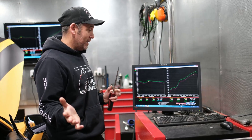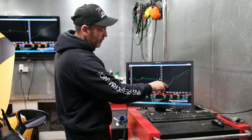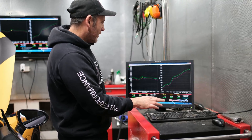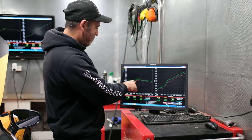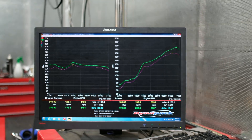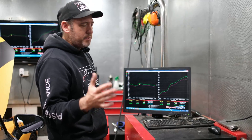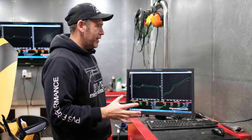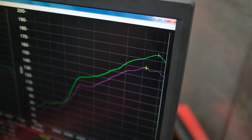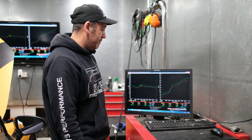On our 98 tune — shown in the purple dotted line — and I think that's green for our E85 line. We made about 160kW on our 98 tune, same headers, same everything — we've just done the flex on top. That's pretty normal; anything around 160 to mid-160s depending on the day is what we've been seeing. That's about a 10 to 15 kilowatt gain from standard, since they're normally anywhere from the mid-to-high 140s. The E85 is basically another 10 to 15 kilowatts above that again.